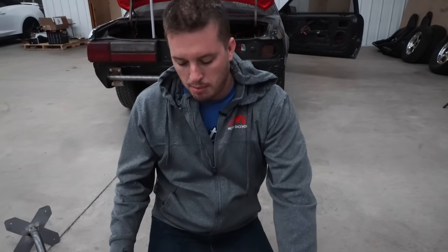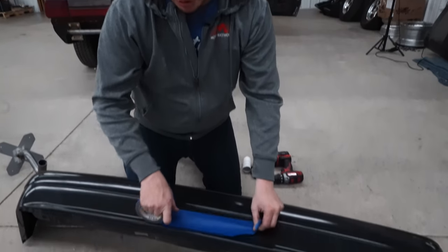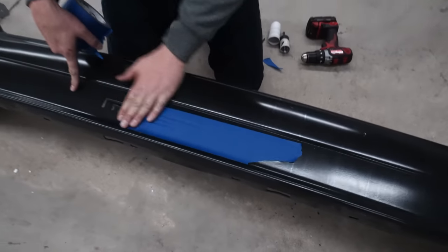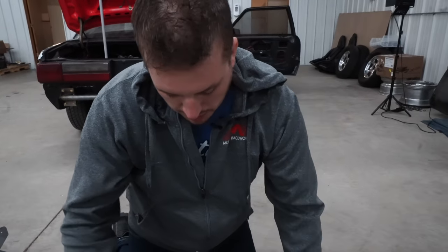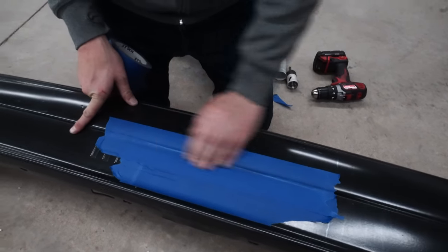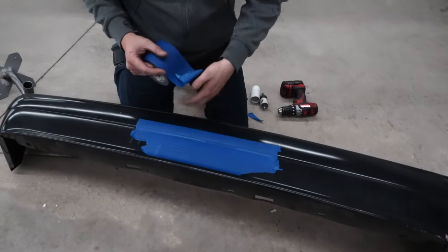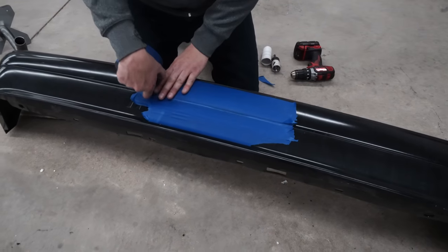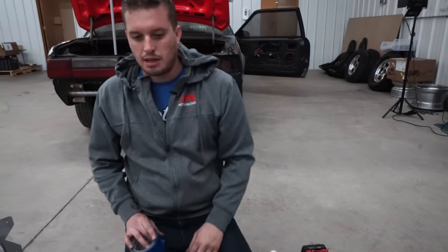We're going to go ahead and put the bumper cover back on the car, but before we do, I'm just going to put a bunch of blue painter's tape over the area where everything's going to come out. You could do this as the next step after you pull the bumper cover off, but I'll show you now. When you drill your hole, make sure this tape is nice and tight — no bubbles, not loose. When you go to drill from this side, it's going to keep the paint from twisting, flaking, and everything else. Don't skip out on this step — you're going to tear the paint.